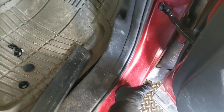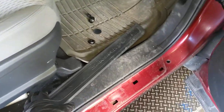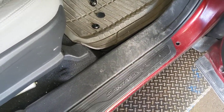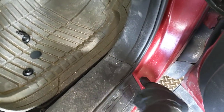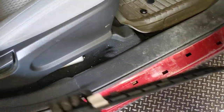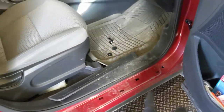If you follow my channel or have seen my videos over the years, you'll remember this is something that really irritates me. You have these rocker panel covers here, and some numbnuts has taken a half-inch drill bit and drilled out an access hole there, when all he had to do was grab a flathead screwdriver, take the clip off, and look — one, two, three, four, five — it covers the same spot.